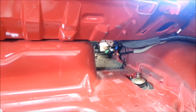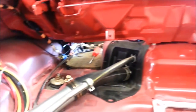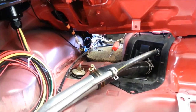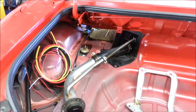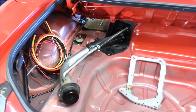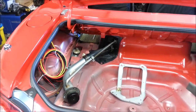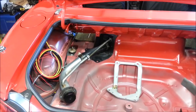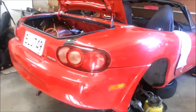I expect I'll be able to fit something up in there - maybe the vacuum pump over this side - and connect it up to the original fuel pump wiring so it'll come on with the car. I might have to do a little bit of tweaking to make it come on, because apparently it's driven by the engine computer, so we just bypass that and make it come on with the key instead.